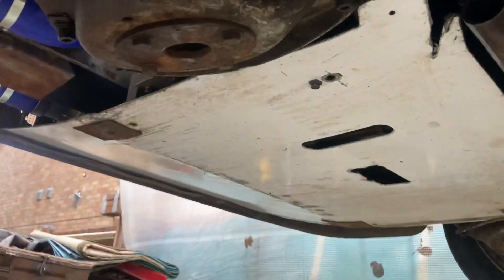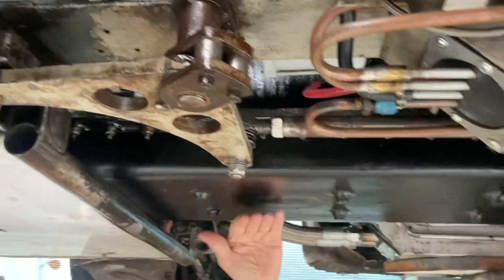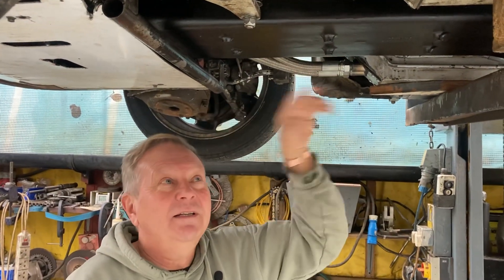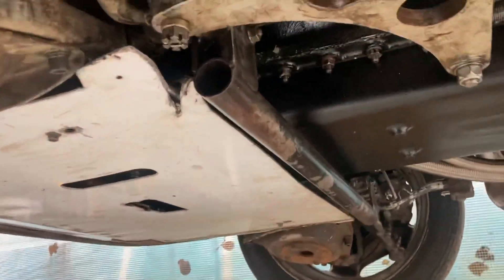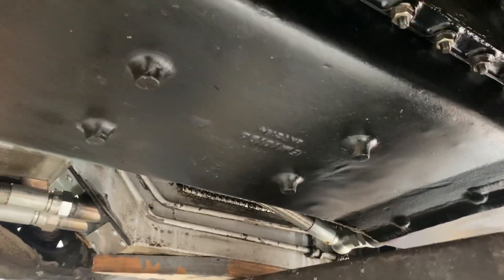You can see the odd spots of oil on various things — it's just chasing oil leaks down, keep wiping them off. The worst thing with these engines is the sumps are porous — terribly porous, they pour oil freely. I ended up trying a sealer for petrol tanks, almost like silver paint, after researching online. I got onto a company called Impregnation Solutions and he sent me a link. It takes four days to set but it works. Normally you'd have spots of oil all over these.